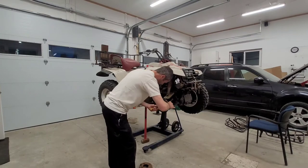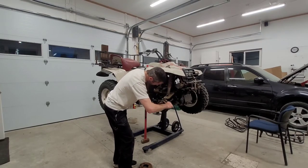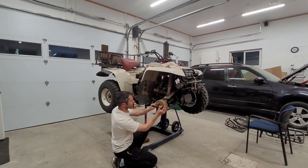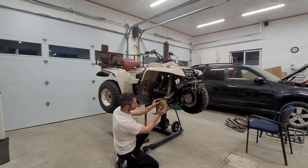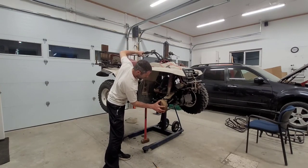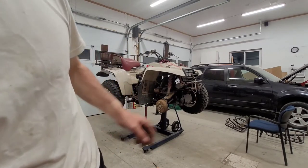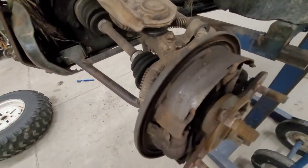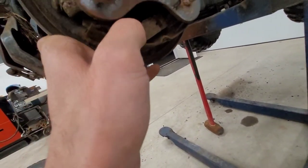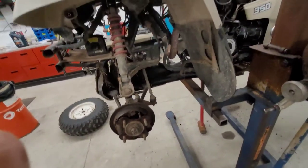I'll clean up a little bit of that dirt to get in there, and I'm going to try and do this evenly on both sides, counting the notches. That actually feels pretty good. Now we've got a bit of pressure — we've got some brakes! Let's go check the other side. Unfortunately on this side, unlike the first side, it's got no liners — this is completely bare metal. I'm going to have to get some more brake liners. There's really not much I can do for now, so that's going to stop me on the front brakes. Let's go to the back and see what we can do there.